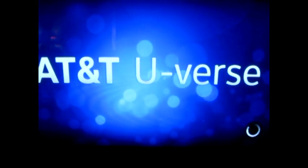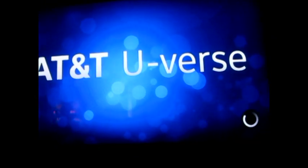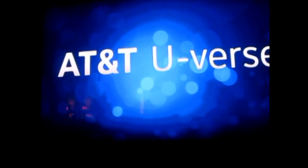Okay, now the box is recognized, and you get the AT&T U-Verse screen, which comes up, and you'll see the power light is no longer flashing. And you have your link light and your HD light. So you just wait for this to boot up and it'll go back to normal television, and then you can check the stats and you'll be good to go.